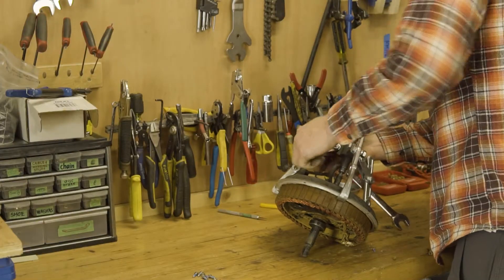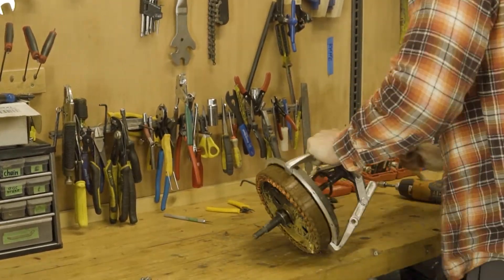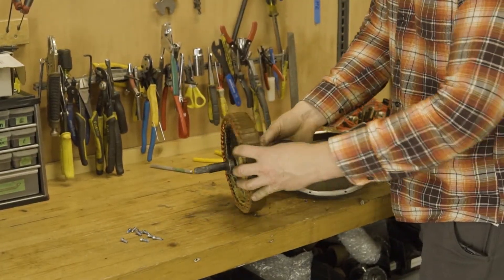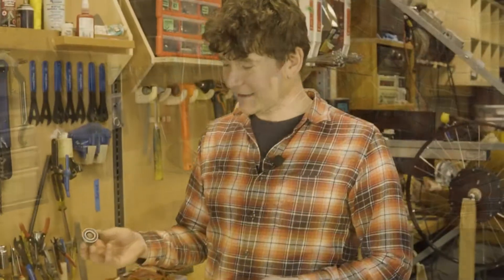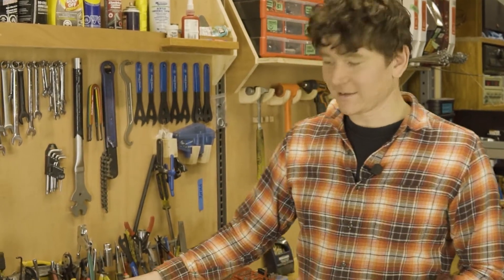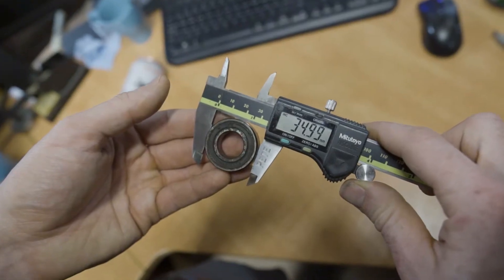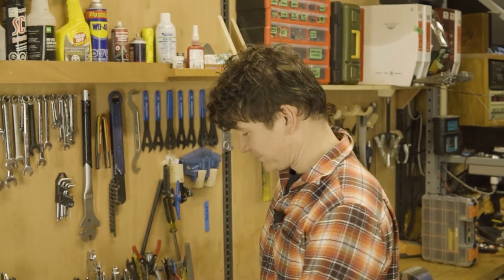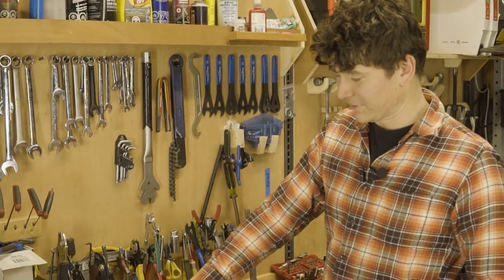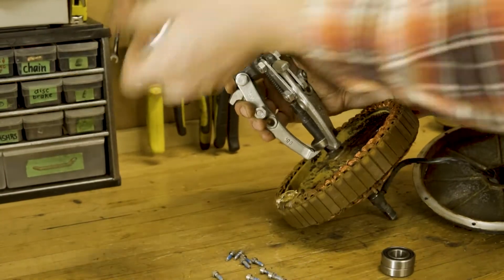If you feel the ball bearing on here it's got quite a bit of play but still has its lip seal on it. The ball bearing that's really shot is the one on the inside, so we're going to use a gear puller to push the cable side out and assess things. We have a couple of spare bearings of the same size on hand. Most import hub motors are going to have a metric bearing — you can just measure the axle diameter and the outer diameter. It'll be one of the very common ball bearing series that you'll normally have no problem sourcing online.